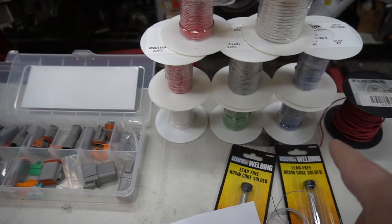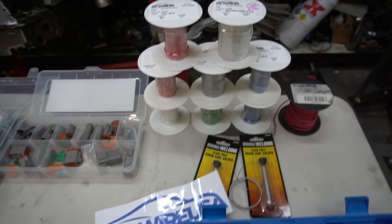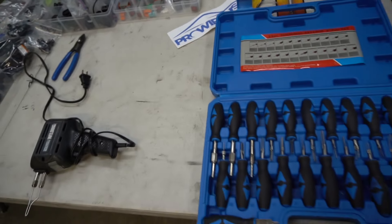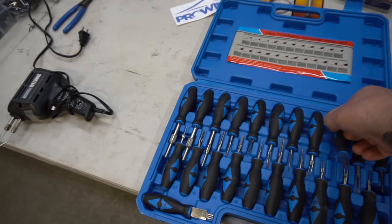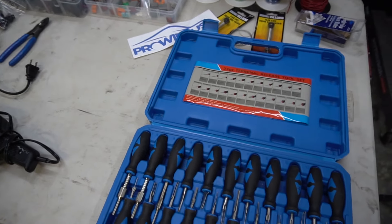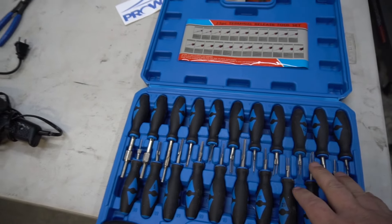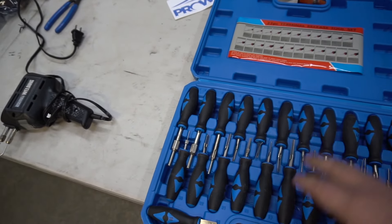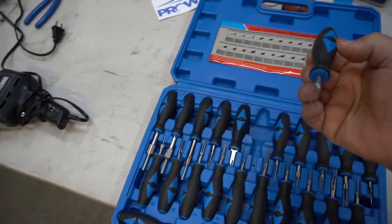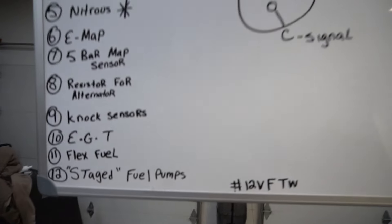All the different wiring gauges and everything we bought from Pro Wire USA — they're not a sponsor, but you always got to give a shout out for really good service. I'll be showing you today some of our terminal release tools we use to de-pin the harnesses. A lot of people ask because you can go to Snap-on and buy a $700 set, but I'm using a $40 set from Amazon Prime and it works just fine. Ninety percent of this stuff isn't even useful since Volkswagen tends to use a lot of the same connectors.